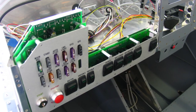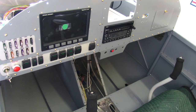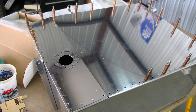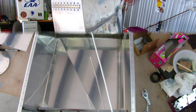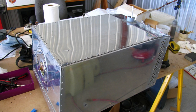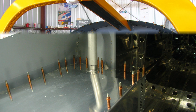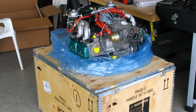In September we started on the instrument panel. Here's the fuel tank — you had to assemble it with a lot of ProSeal on the inside and special rivets. We then leak-tested it to make sure everything was sealed, and put on the filler neck and piping down to the fuel tank.